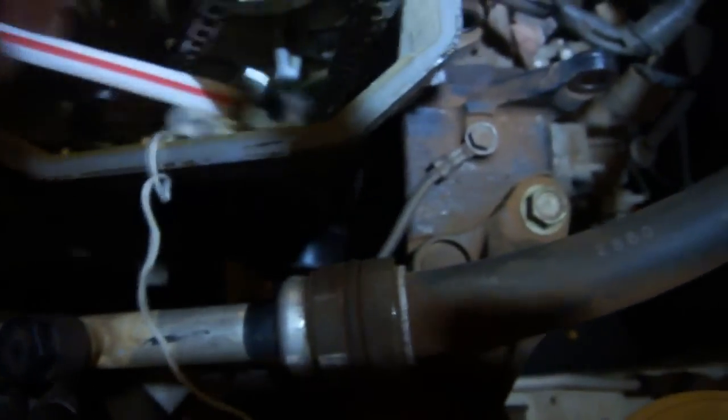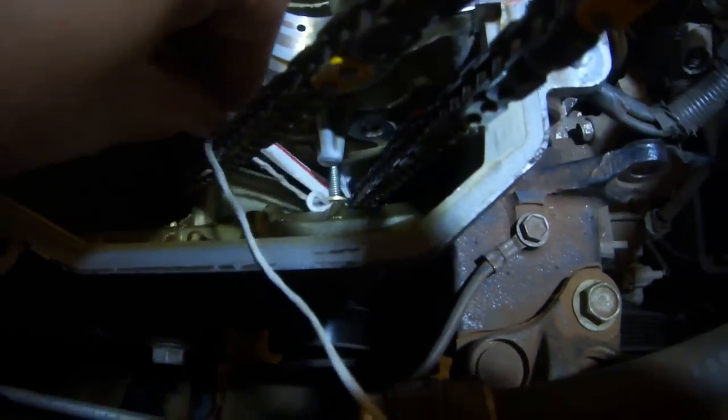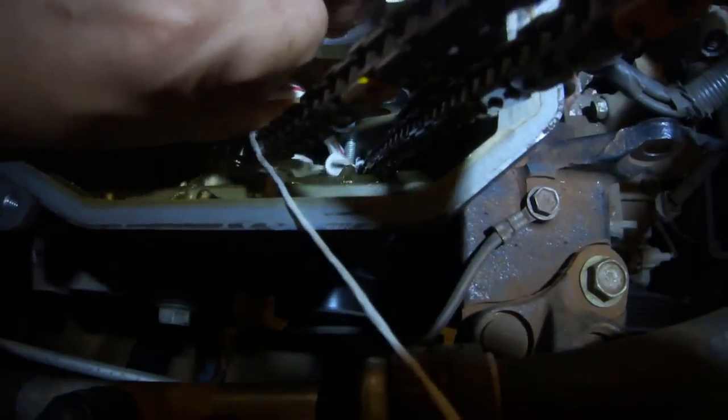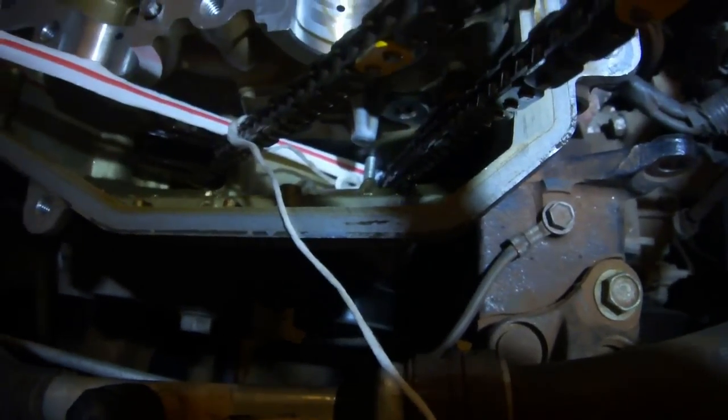And I've tied the other end of the string to the car. Now I'm going to use my magnetic capture tool and attach it to the bolt, and then I can simply put the bolt into the hole. Now I found I could not, unfortunately, put a ratchet over this bolt and install it that way. That would be the easiest way, of course, and I just couldn't do that.